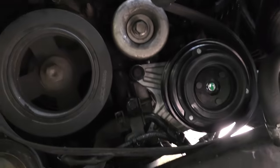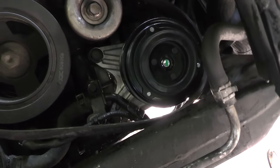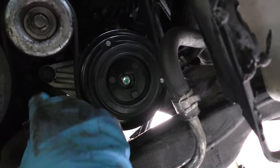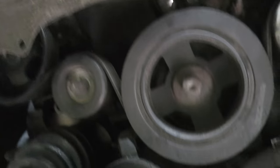We go inside and bolt the compressor on here, here, and on the bottom. Then put the fan belt back on — you pull the tensioner, it loosens, and you snap the belt on. The belt is now on nice and tight the whole way around. Feel to make sure it's on tight — you don't want it loose in a groove.